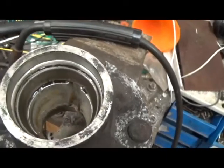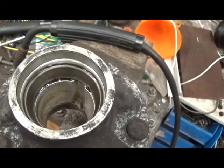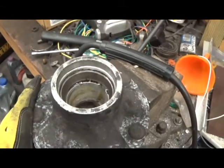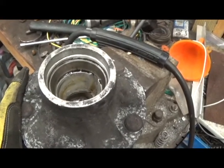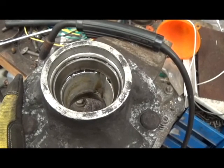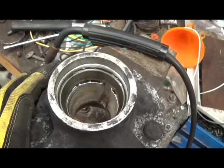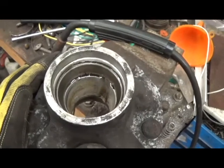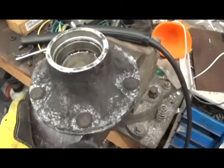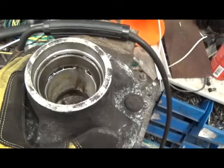But if you just hammer on that, a few things happen. You're really close to the wall — the part of the aluminum that the race goes against — and it's very easy to scratch it up. These aluminum hubs are pretty soft, and if you scrape some of that aluminum out, even if some comes out with the bearing race, you start losing material for your interference fit. Eventually there's not going to be enough material to hold the race stationary, so the race will start to move in your hub, causing the bearing and hub to fail. The 944 is 30 years old or more, so we want to treat this aluminum nicely and preserve the parts.